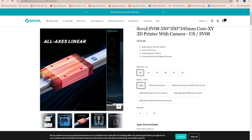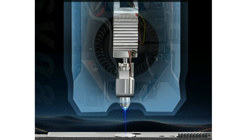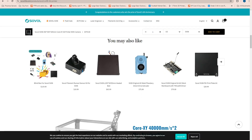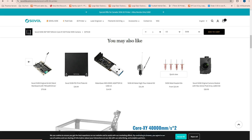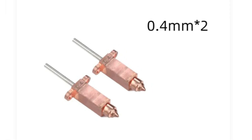So I pressed the plate directly against the nozzle and I thought it would trigger, but it didn't. I moved the plate around a little, and this is where I realized what the problem was. The Sovol SV08 uses a nozzle that is designed to basically be press-fit together. The nozzle itself — that entire section at the heat break and below — is all one part. It's very similar in design to the original Bambu Lab nozzle. The nozzle is not screwed in like on some 3D printers; they are pressed in. And to the extent that they're pressed in, that means they can also be pressed out. Ideally it's just not supposed to happen.